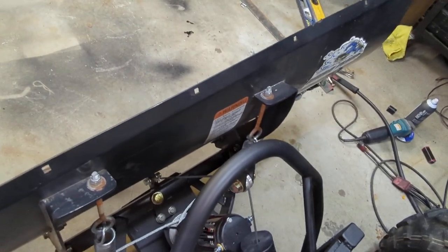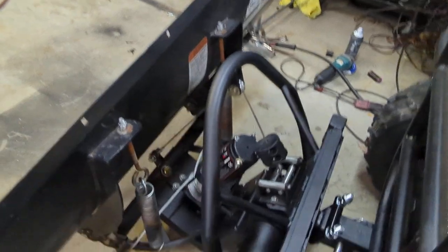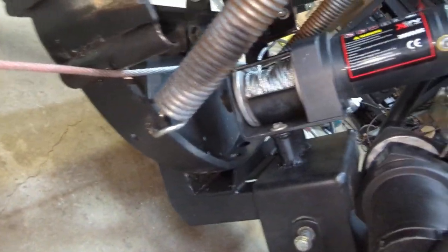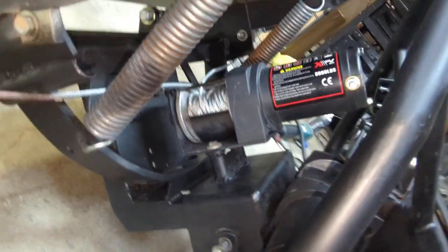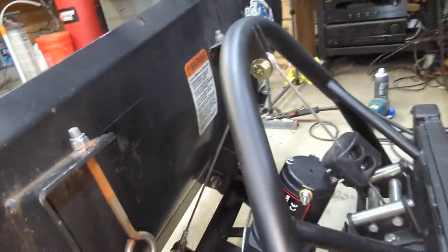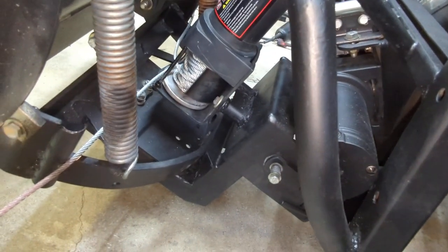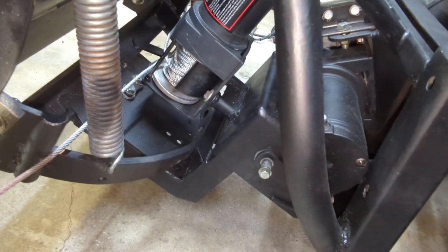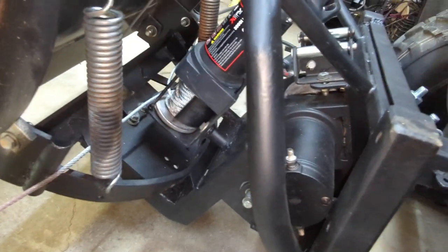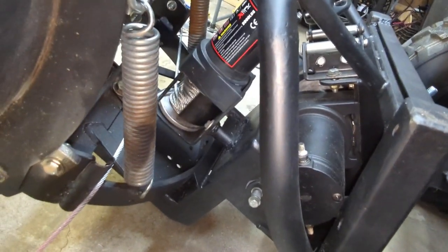Now, the angle, like I was saying, was manual and I didn't want that. So I rigged some standoffs up. I don't know if you can see those two standoffs with the little gusset in between. To get the winch away from the mount and the winch for the up-down of the lift — which is here — you can see the cable going there to that snatch block or pulley, down there. That's the up-down. What I did with this is bound the cable on the winch for the left-right angle so that as one cable was letting out, the other cable pulls in. So essentially you hit the winch in, it pulls this left, tightens that, and lets cable out the other side — and opposite the same thing.